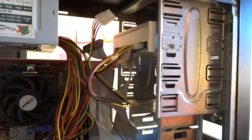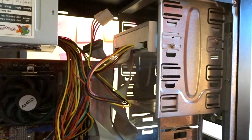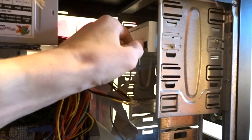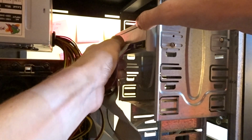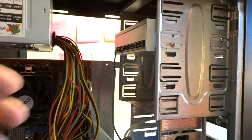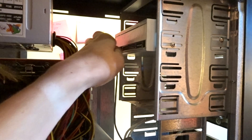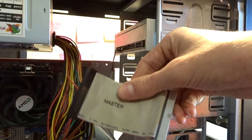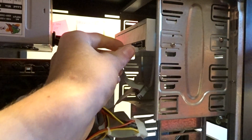Okay, there's our hard drive. I'll leave the CD-ROM there. I'm going to move that. There's a master/slave jumper here - I need to change this to master. It's currently set to slave. I'll set it to master. Master - that goes in here.